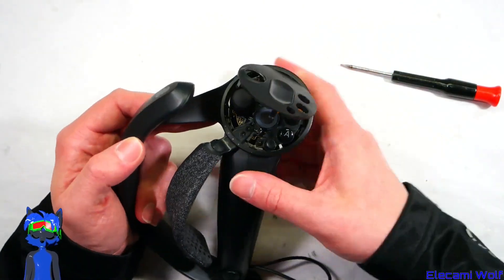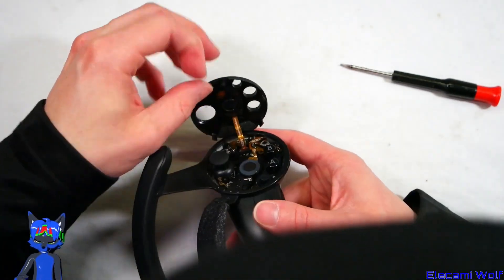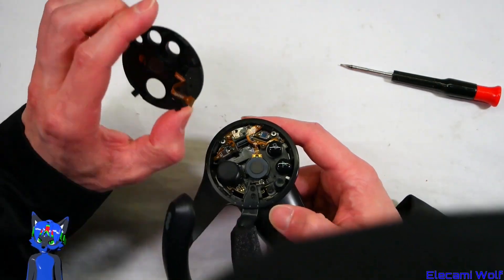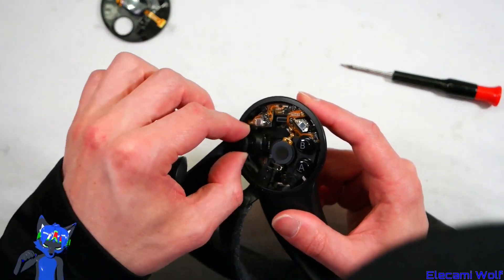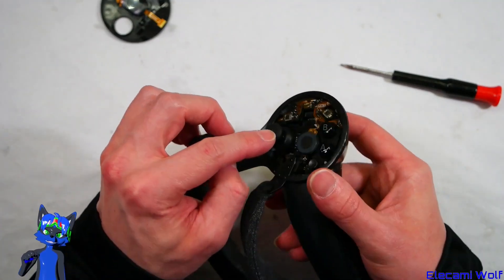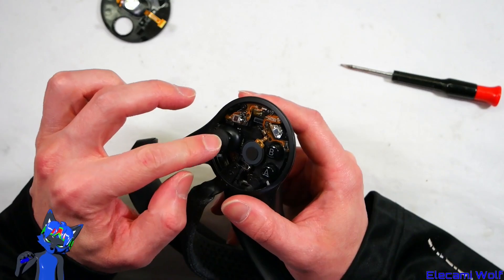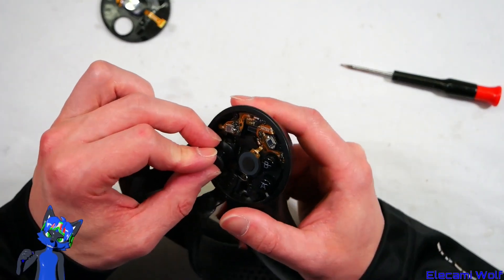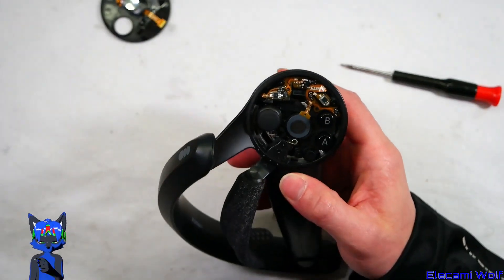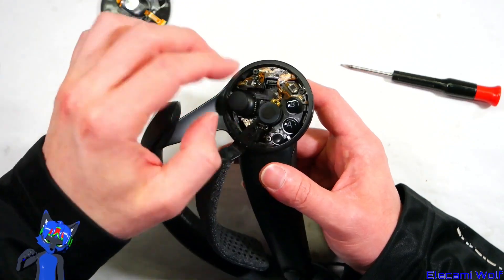There's tape around there as well. You can see that the cable from the touchpad is still attached there — carefully wiggle that out and watch because there's thin bits of double-sided tape around the edge. Before removing the joystick top, be very careful because there's a ribbon cable that comes from the touchpad down the top edge and onto another part. You need to be very careful not to damage that, as we'll have to take all of this out in order to replace either that ribbon cable or the stick itself.